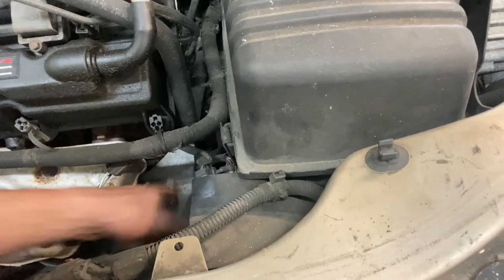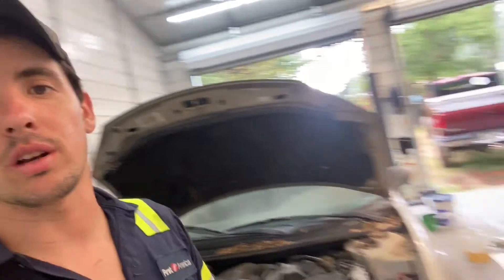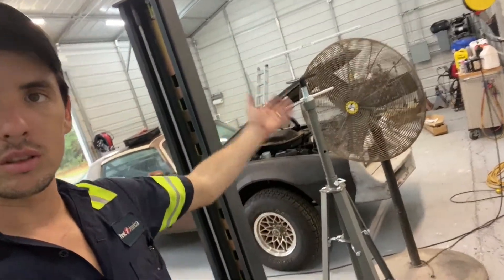You can barely see it right here — you can see it better underneath the car. Which means you have to pull the motor mount out to get to the top bolt that holds the starter, and it actually goes through the motor mount and holds it to the car. That means I have to support the motor once I take the motor mount out, so I can get the starter out. I had to go buy a hoist jack stand to hold the motor up. Takes a 20-minute starter job and turns it into an hour and a half, two-hour job.